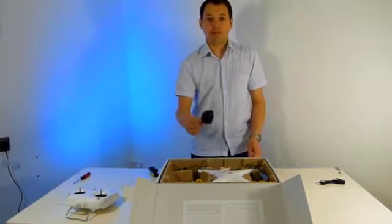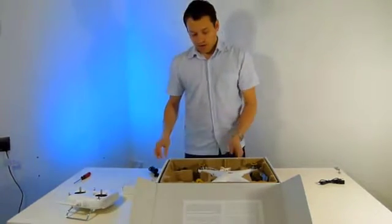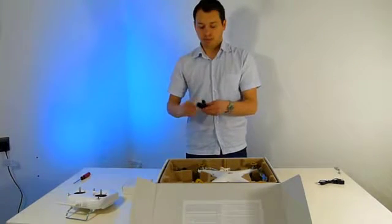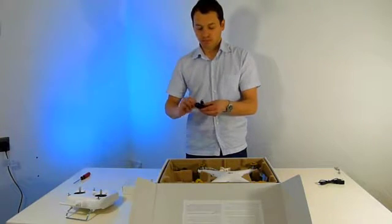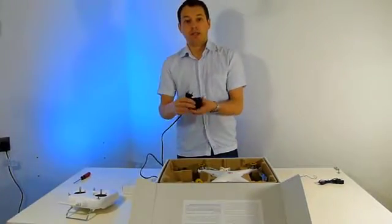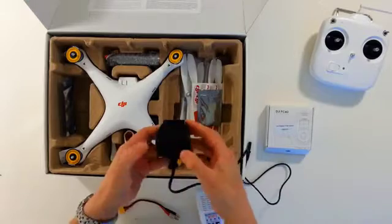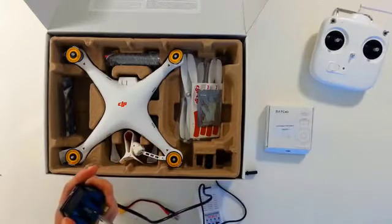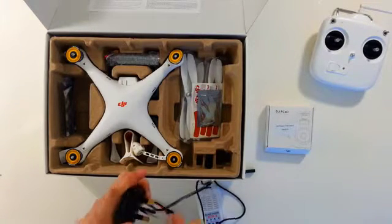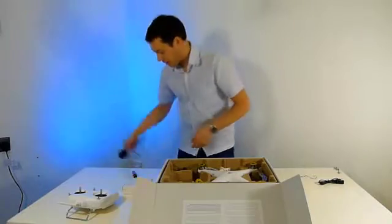In your box at the bottom sort of left you'll find this Euro adapter plug. You'll see it's open like that. If you uncoil your power cable with the European 2-pin plug on it, just undo that, extend that out, take that, put it inside your Euro adapter, make sure it's nice and firmly in, close the lid, take a Phillips screwdriver, tighten the screw up, make sure that's good and tight, and now you've got a UK plug with a fuse and everything else, which is great.